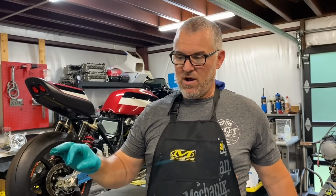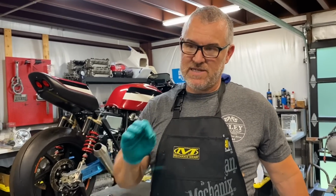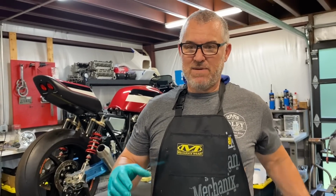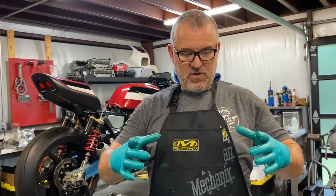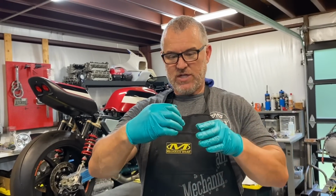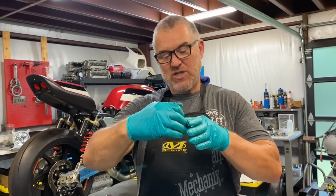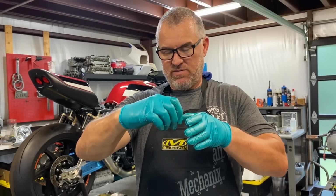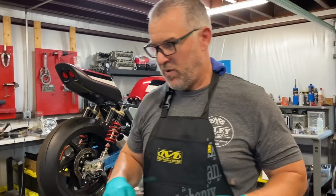But I think somewhere in the machining and the design of this piston, something got overlooked. I don't think it's an issue on the 1224 piston, because the piston's slightly larger. The ring groove is the same width ring, and so there's less overlap in the area. So there's more material, if that makes sense. And I'm going to show you what I'm talking about.